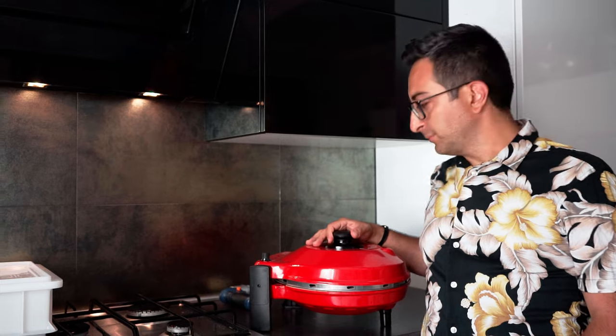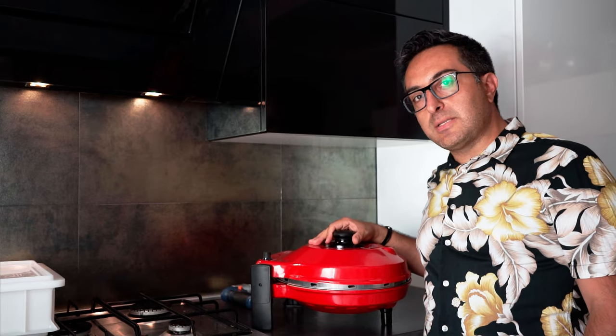What we will need to do is to disable one of the two thermostats that we have here, which limits the temperature to 300 degrees Celsius. And we will change the calibration of the other thermostat in order to have the resistance turned on for a longer time. So follow me and let's have a look at what we need to do.